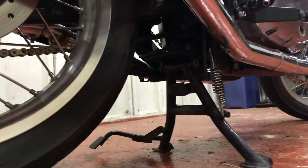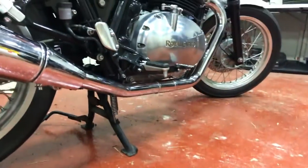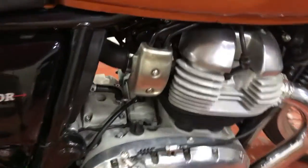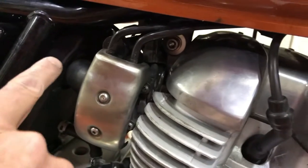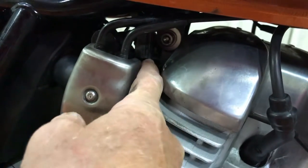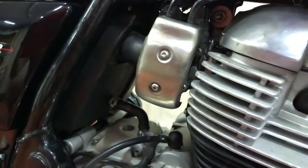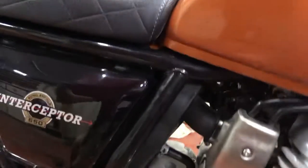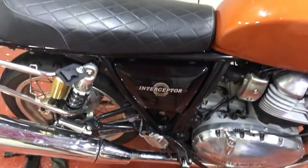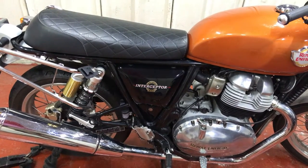This is where the system used to live — under there. If you look at your own bike you'll see it. And if you look on the inlet manifolds, the kit includes two of these little bungs — they sit on top of the inlet stubs that the pipes connect to, one either side. Now, the trickiest part: if you read the manual, it says you have to remove the side panels, the seat, the ECU, the rear mudguard, the inner mudguard — all sorts. It seems a bit insane.